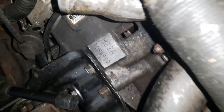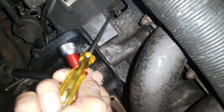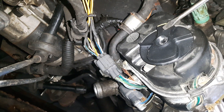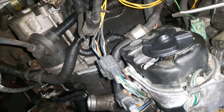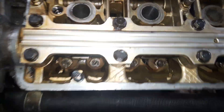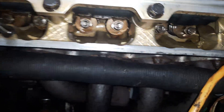Right now the timing mark is perfectly aligned. Through this hole you can see the white mark, and this notch has to be aligned. Also make sure the rotor — I took the cap off — is at number one cylinder. When we aligned at TDC previously, the rotor was sitting at nine o'clock instead of around seven o'clock, which is why the car wouldn't start. The low compression was because this cam was off by about 30 to 50 degrees, keeping the valves open.